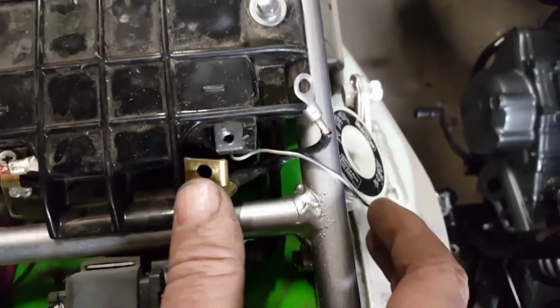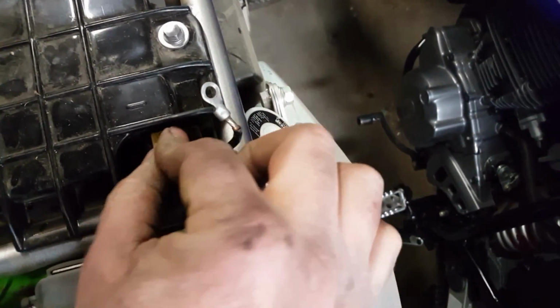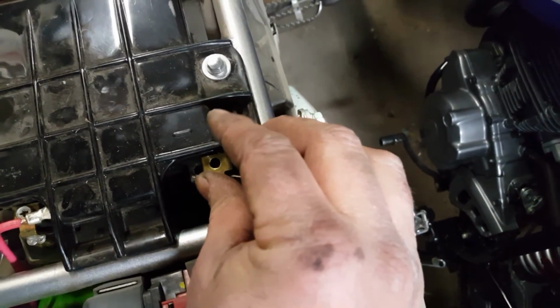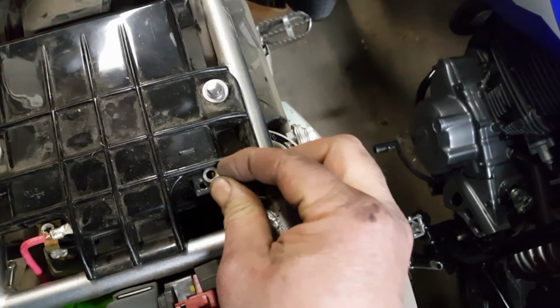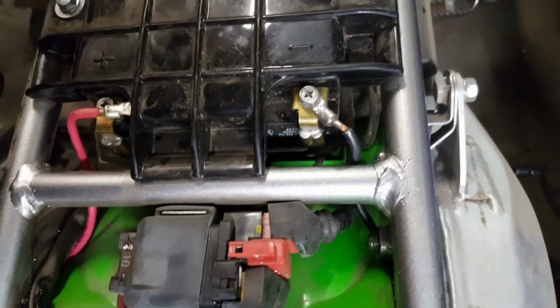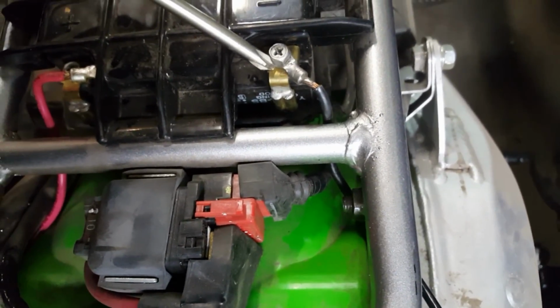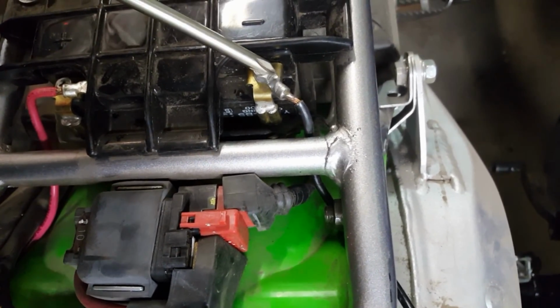So now what we want to do is line up this where it was. Place this on top of it. Line up the holes, put them in the screw, and tighten down the nut. As long as the nut stayed up high, we'll be able to grab it with the screw. Alright, that worked. Solder held the nut up. Able to put in the screw, grab the nut under this bracket, the original factory bracket, and our new terminal.